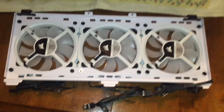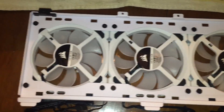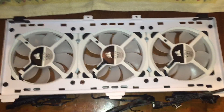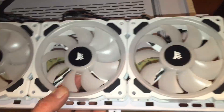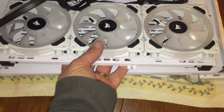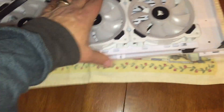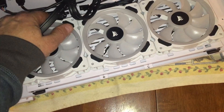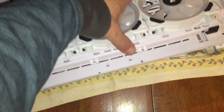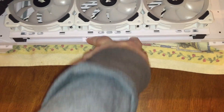When installing three fans like this, I just put them in so they're loose but secure and I can adjust them before tightening them up for a final tightness. On this case the frame that mounts the fans comes out — we'll slide that back in. Just make sure you don't crush any of the wires back here. It snaps down like that. Two screws go here, so we'll put those in.